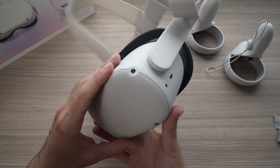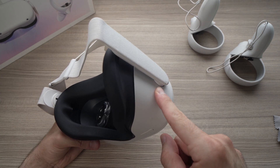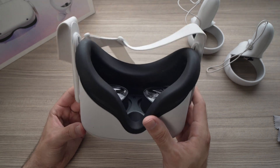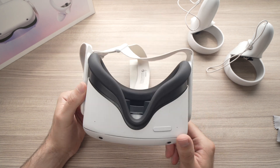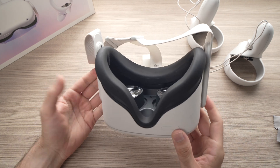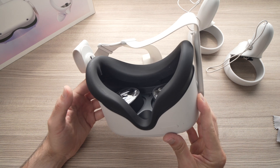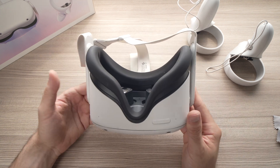Finally, once you're done, start the Oculus Quest 2 by pressing the power button for five seconds and you'll hear it booting up — release and hopefully this will solve your problem. If this solution didn't work or you're not able to turn your Oculus Quest 2 off completely, press the power button for 10 to 15 seconds so it will restart automatically. Hopefully when it restarts you won't have this problem again.